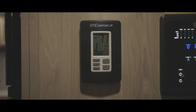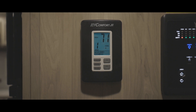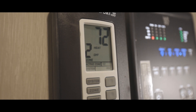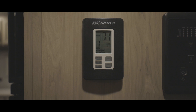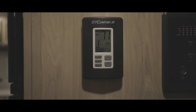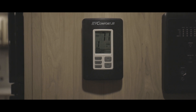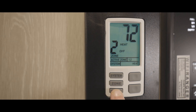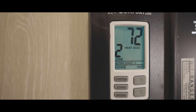The thermostat has two zones for controlling the temperature. Zone one is the main kitchen and living room area of the trailer, with zone two being your bedroom. If your RV has bedroom AC, you will use zone two controls to work that AC unit. The optional bedroom AC from the factory includes an electric heat strip built in. To utilize that heat strip, be sure that you are on zone two, then select heat with the source being electric — because you're turning on that electric heating element in the AC, not adjusting the gas furnace.